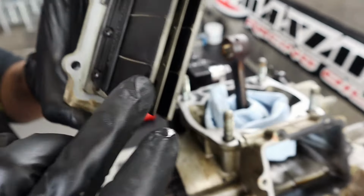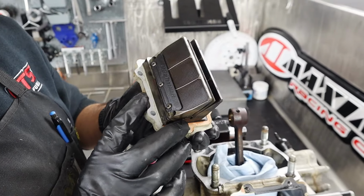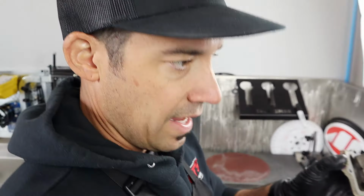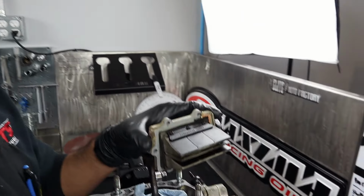The old Honda reeds used to just gobble up like crazy. This was the trick, throw a V-Force in it. Why was that? Did they just flap too far out? Fragile, like no control? I think the stopper on it, the reed would come up too much, and then it would break. Like those metal stoppers they had, because it concaved. Came out like here, right? They're like flared?